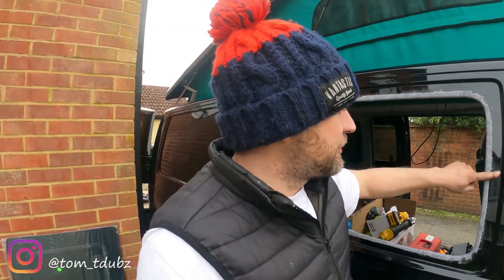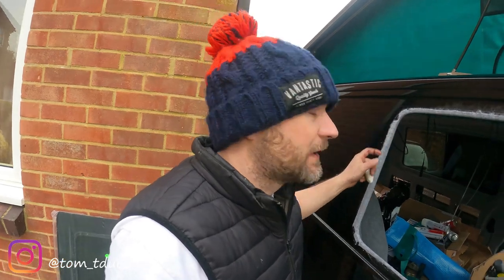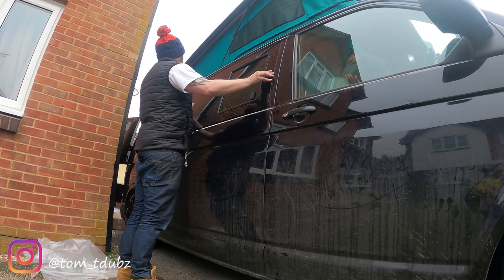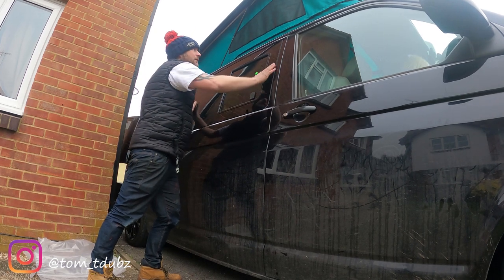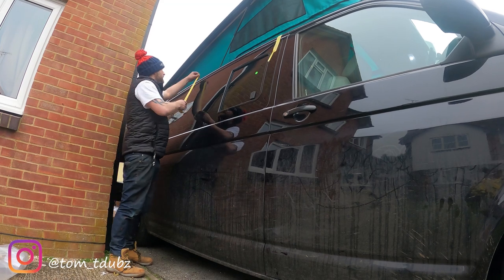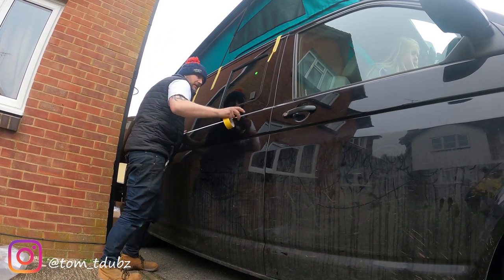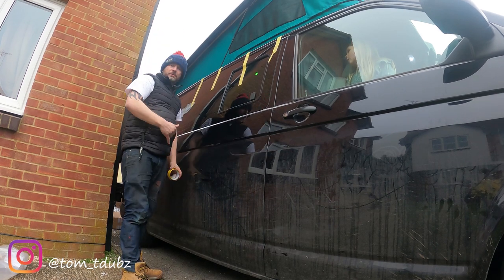Now we can get the glue residue cleaned up around the outside, give the van a little bit of a wipe down, get the glue on and cleaned up, and then get the window on. When you put the window in itself, I suggest you work from the top first and then ease the window in downwards — you can then get the position you're looking for. Once you've done that, get your masking tape out. The masking tape will hold the window in the position you've left it in — it's not physically going to hold the window on, but it won't drop from that position.